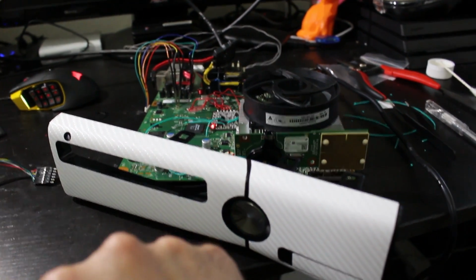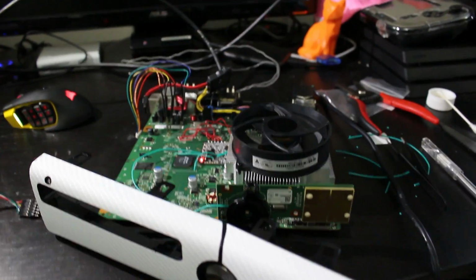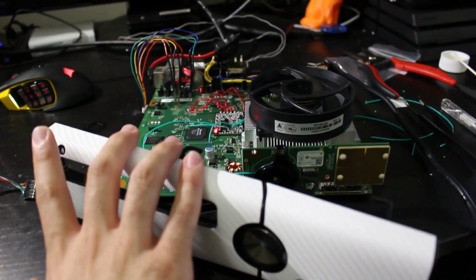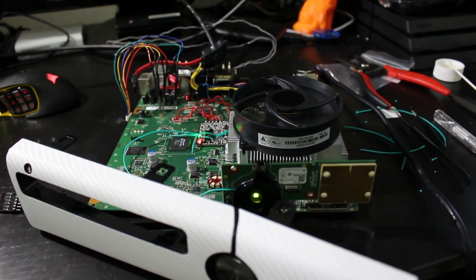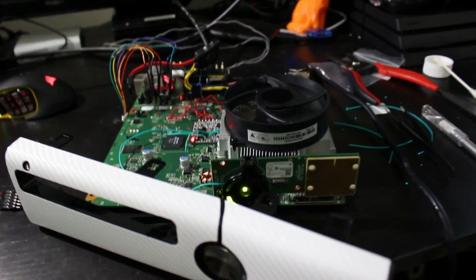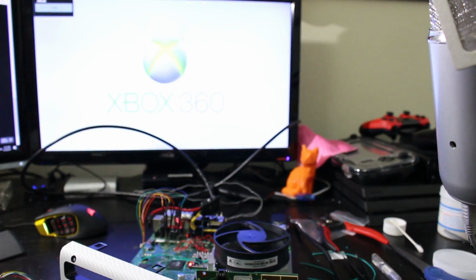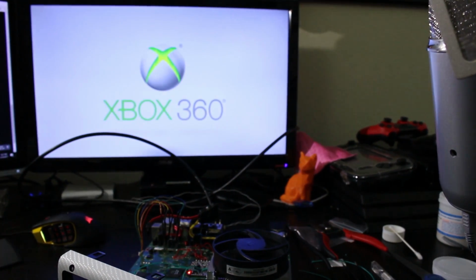On top of that, if you want to reflash your retail NAND, you just flash it like a regular retail system. You hold down the sync button, it's going to pulse 2 times to go into the Viper NAND, and then at that point you can use Flash 360, Simple 360 Flash Tool, or anything else really that you want to, even Zell. You could use any of those methods to reflash it. You just treat it like another system on there, just a normal system.